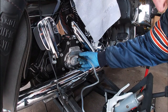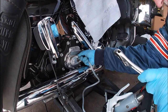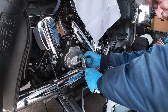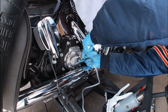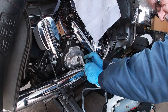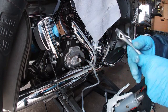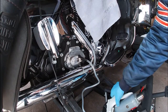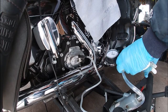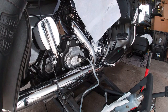I'm going to crack it open first. If I had the correct wrench we'd be in business. Alright, that's it — we're dripping fluid now, that can go on here. Now we're going to put a little bit of pressure on that with the Mighty Vac and run to the other side to make sure we stay topped off.